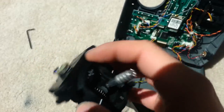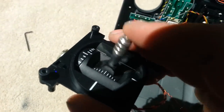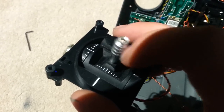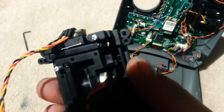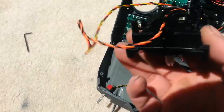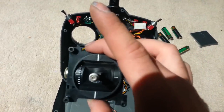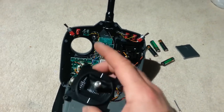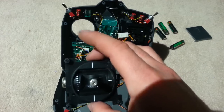You will have to reconnect the springs onto their adjustment sliders and then put your screws back in. Once you get your screws back to the tension you like, it should look like this — nice and smooth, no binding, no noise. If you hear springs clicking or clanging, you know you have something hooked up wrong. Put your retainer clip back in so everything stays sturdy, then plug back into your circuit board and put all your screws back. Turn your controller back on and go back into your monitor selection, check your movements, and see if that has helped you.